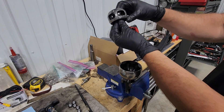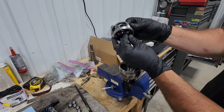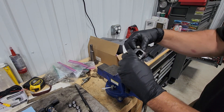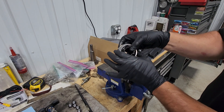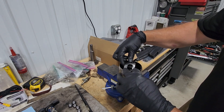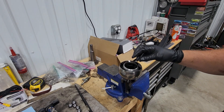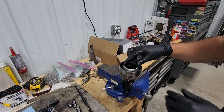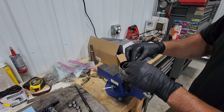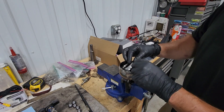We've got our outer stub shaft all cleaned up. We're inserting the cage — as you can see, there's an inner and outer cage. The top of the cage where it really tapers in is going to point out; on the inner cage where you've got the taper on the bottom, you can see there's a groove here for the retaining ring on the axle shaft that will go down. To put it in, you're going to line up two of these flat spots with — four, I should say — four of the ball bearing slots, and you'll be able to slide it right in and then rotate it into position.